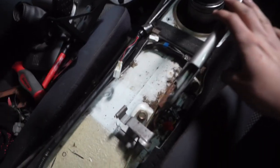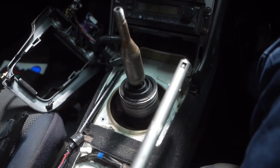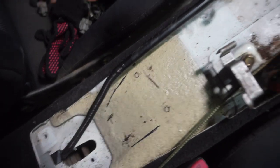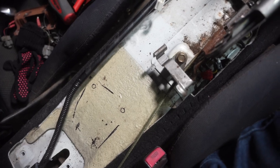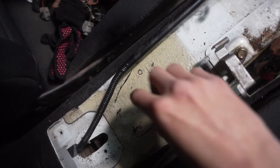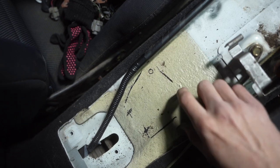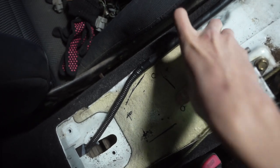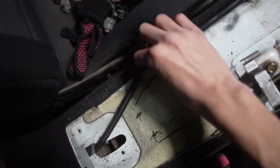I got the e-brake all set up, I cut out the center console, and I started removing the shift boot. I had to make sure over and over that I had enough clearance — I don't. I do have to cut the center console out just a little bit more. But other than that, I'm ready to start drilling these holes out. I'm gonna get my center punch out, center punch this, and then bolt it. GK Tech says you're supposed to bolt directly to metal, but I do have this sound deadening and this stuff's kind of a pain to remove. So I'm just gonna bolt it to the sound deadening and hope it doesn't affect it too negatively.